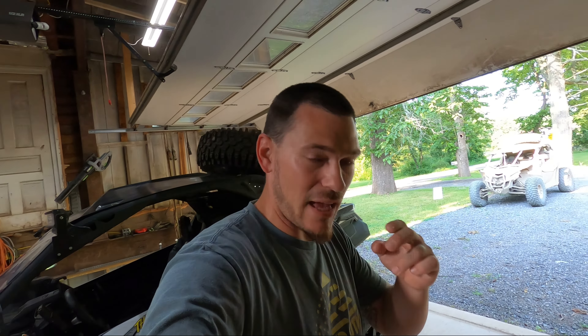What are we doing today, Coop? Changing that... trailing arm. There you go — I'm learning them. All right, so instead of tying the axle up, we just went ahead and pulled the axle. I'm getting to the point where I need to do maintenance and grease it anyway so it doesn't strip the splines. So we're going to go ahead and unbolt the trailing arm up here. Coop, hold this so it doesn't fall. I'll keep this bolt separated so I know where it goes.